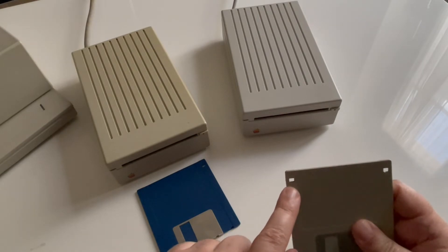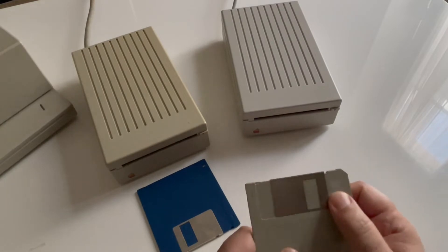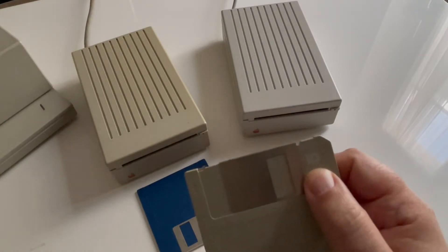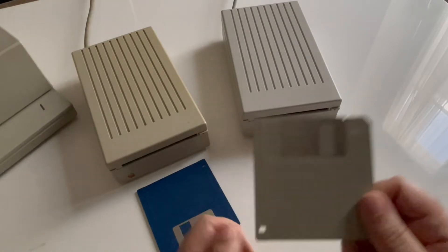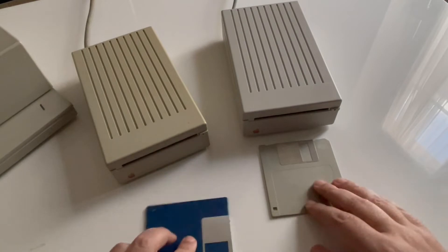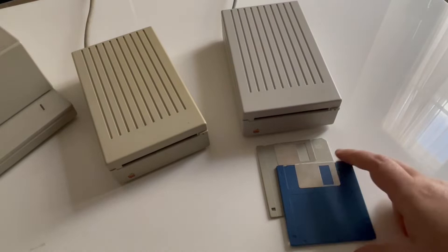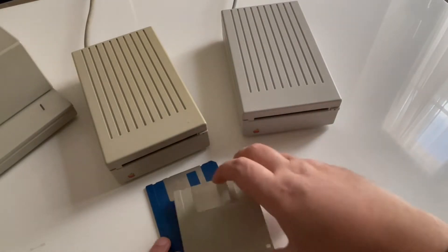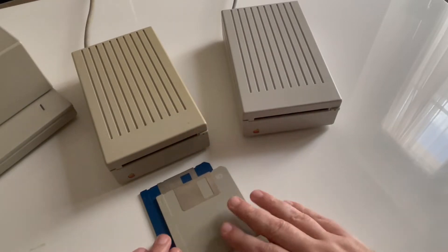The second hole is to define its identity as an HD disk, and also on all of them you have an HD logo on the corner of the floppy. So an 800k disk can run on the SuperDrive, but a 1.44MB disk cannot run on the classic drive — it will only be recognized at 800k, so you will lose a big part of the space if you format this disk on the classic drive.